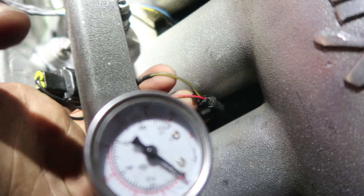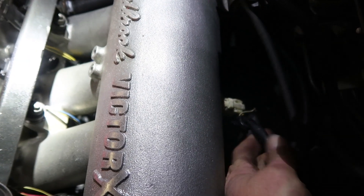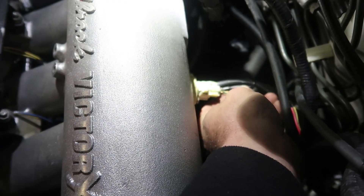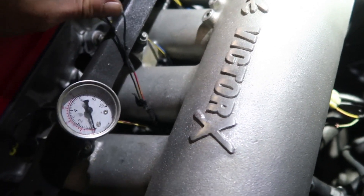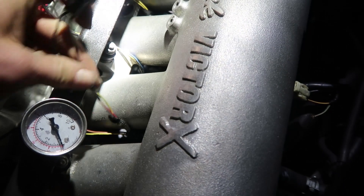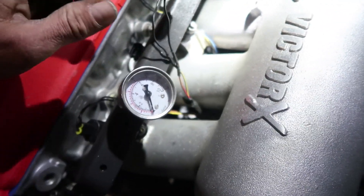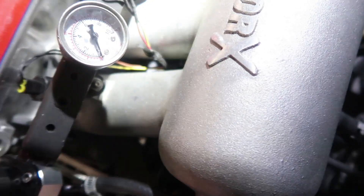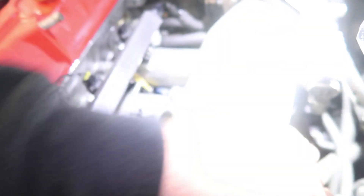Investigate a little more here. See how this wire has got a yellow stripe on it? And this one is black with a yellow stripe - that's looking more like the purge solenoid one. I'm going to make sure that wire's not broken too. We've got an issue with the air temperature sensor and number two injector. This should also have a yellow with a black stripe wire, and then plain red. You can see this is red with a yellow stripe going to the injector too. Good thing we're scanning it - things are all tucked up nice but we can untuck it and make it work.